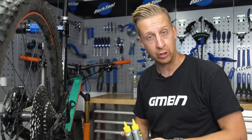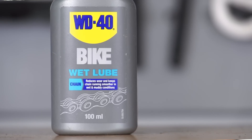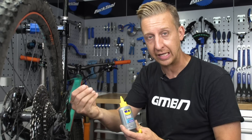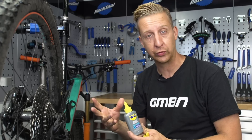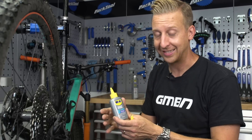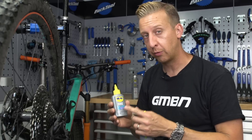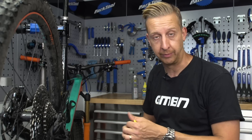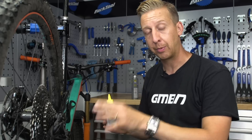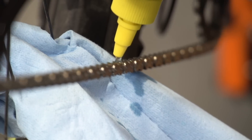With chain lubes you get two types: a wet lube and a dry lube. The wet lube, self explanatory, is a thick wet lubricant designed for use in adverse, wet, grimy conditions. The idea is it's quite thick, so as well as penetrating into those rollers and on the inside of those links, you actually get a bit of coating on the chain that helps keep water at bay and keeps that lubricant in place. Now the disadvantage of a wet lubricant is that the exact property of keeping lubricant on the chain can also attract dust and other stuff that can wear out your chain, so you don't really want to be using this in dry conditions — hence having a dry lubricant. A dry lubricant is aimed at use in dry conditions, and it's still a wet lubricant when you apply it, but the wet stuff in it is literally just a carrier to get those lubricating particles into the chain.